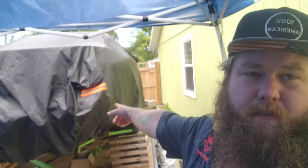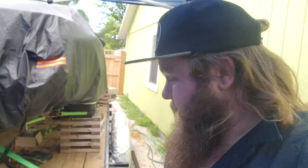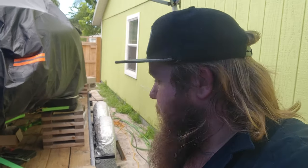But we got E85 sitting in the fuel rails and injectors and everything, so we need to hook up the starter and crank this thing over and let it idle for a little bit, get that stuff kind of cycling through. We've been having a lot of rain, and even though I got nice new cover for it, that moisture, it finds its way into E85. So yeah, that's what we're gonna do today.